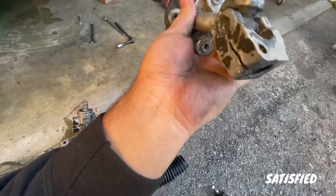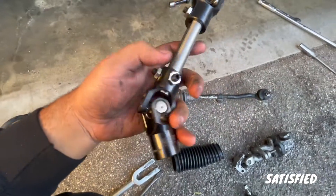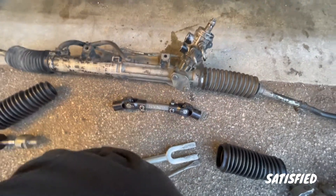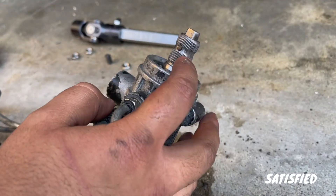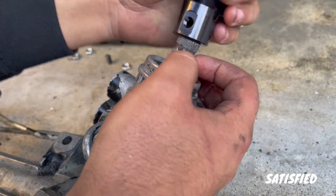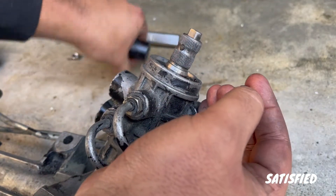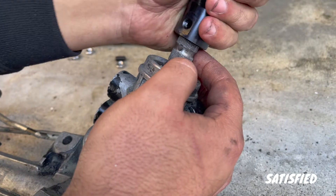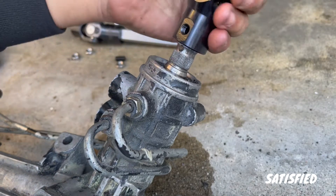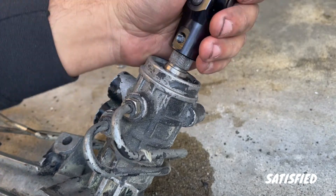All right guys, we got the old coupler out. I had to pry it a little bit open just to get it out because it was pretty stuck in there. Out with the old and in with the new. Before I put this one on let me just clean this up and then I'll show you guys the install for the Condor Speed Shop coupler. Looking at the steering rack there is a hole on the bottom where the column is at, and a hole on the bottom of this as well, so this should line up so we're able to put the screw and the nut in. Let's see if this slides on there perfectly — might have to give it a few taps.